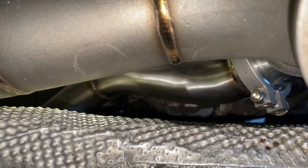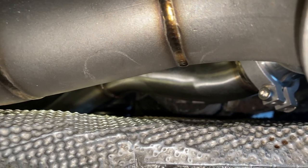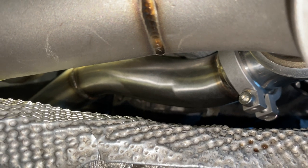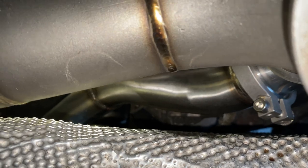What I'm gonna have to do is wrap the dump tube so that way it can retain some heat inside of it and doesn't radiate throughout the whole engine bay. I'm gonna go ahead and take it off, wrap it, and check down at the bottom to make sure everything else is clearing up. I have the manifold in and it's secured up.